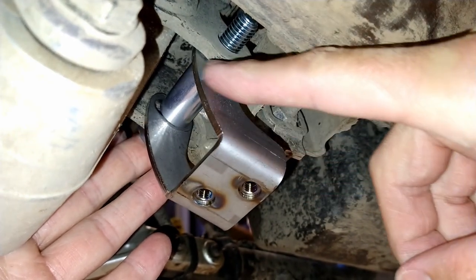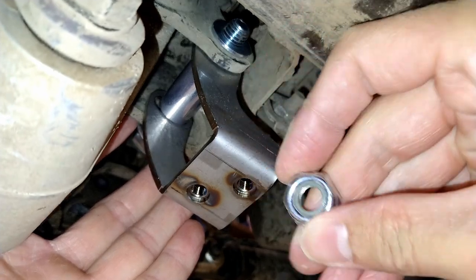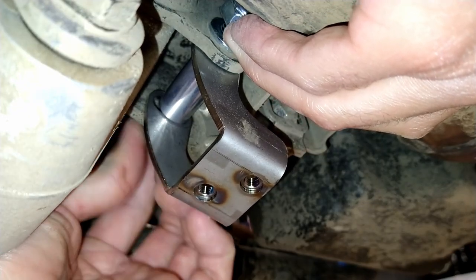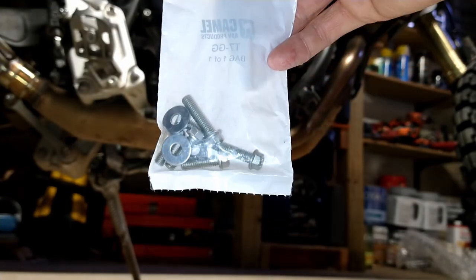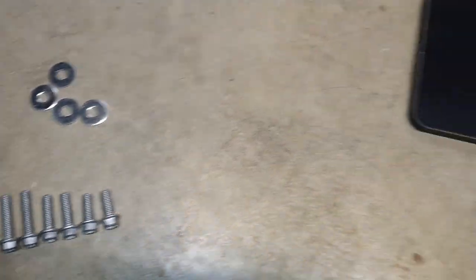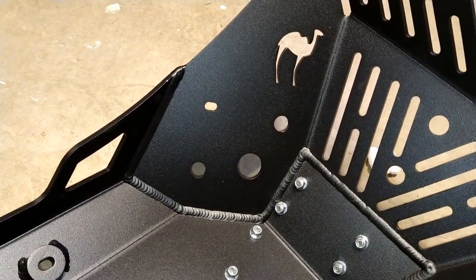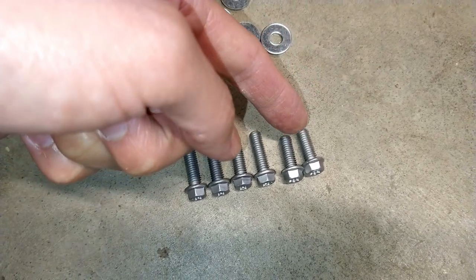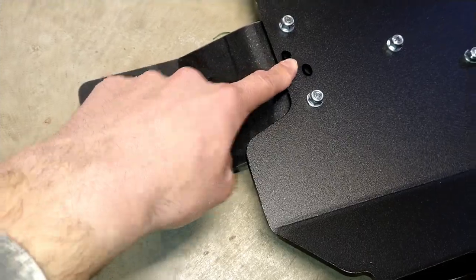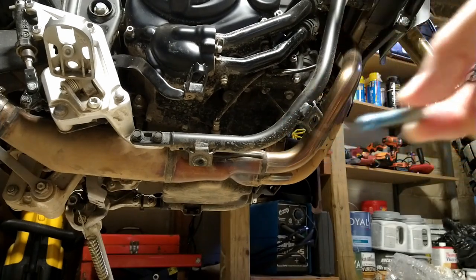The washer for mine — one was on this part and the other was in the little hardware bag, so you will want one on both sides. After that's in place, get your nylock nut and thread that on. This is just going to hang loose until we get the skid plate on it. Now we're going to need to get into this bag of hardware. The longest ones are going to be used in the back of the skid plate because you've got this extra nub welded on. The middle ones are going to be used in the front, where the stock bolts would have been fastened through that oblong hole. The shorter ones are going to be used for the back boot support. The bolts for that back mount are the only ones that do not get washers. Blue Loctite on everything other than the bolt that goes into the nylock nut in the back.